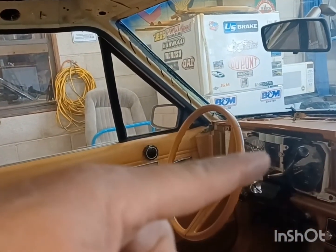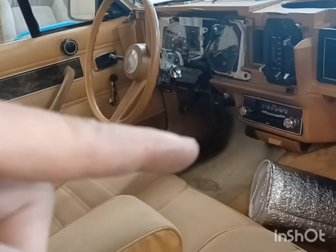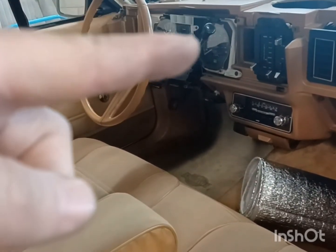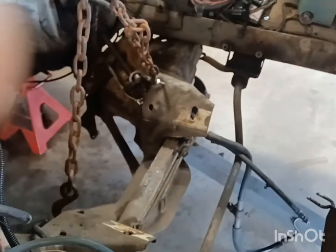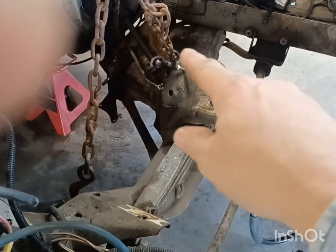All that's got to come out anyway because I'm putting a five speed in this car. Got to pull the pedals out, cut a hole in the floor, get rid of the shifter column. And that snowballed into putting the V8 in — the six-cylinder K-member is different. See these big plates? The V8's not like that, so I'm going to go with a late model K-member.